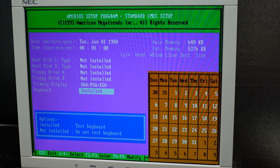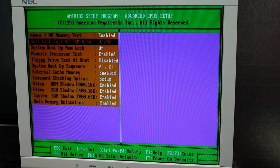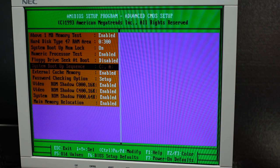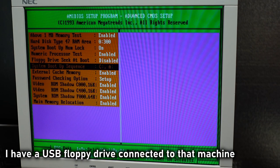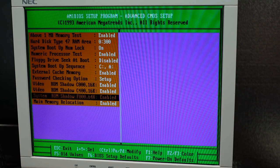In advanced settings, we can test upper memory, there's a floppy drive boot setting. This was one of the early days where you could set the C drive to boot overriding the A drive, so if you left a disk in there, you would not get non-system disk errors. In fact, just the other day I got tricked on my own Windows 10 computer because I left a floppy disk in there and I thought the hard drive got erased. External cache memory — those are the cache chips on the motherboard. And you can do shadow RAM for your video and system ROM, which really increases performance by copying the ROM into very fast 32-bit memory and accessing it directly from there.